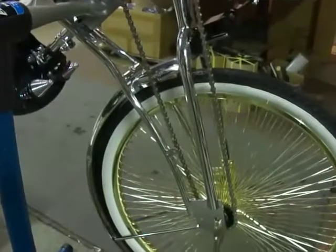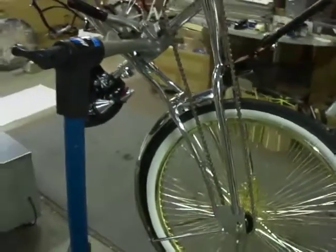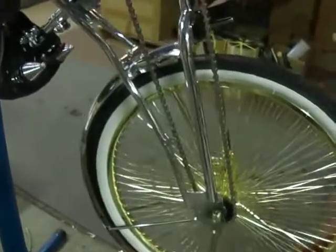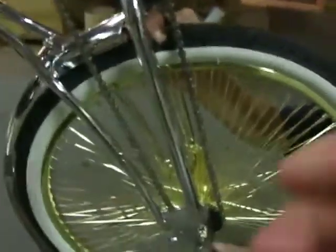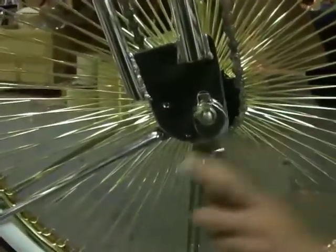The chain is a little bit loose, so we have a bike stand so we can turn it upside down and use gravity. You can tighten it up by pushing the coaster wheel down a bit — just push it down. That makes it tighter, and then you just tighten the coaster wheel nut, and then you have a tighter chain.